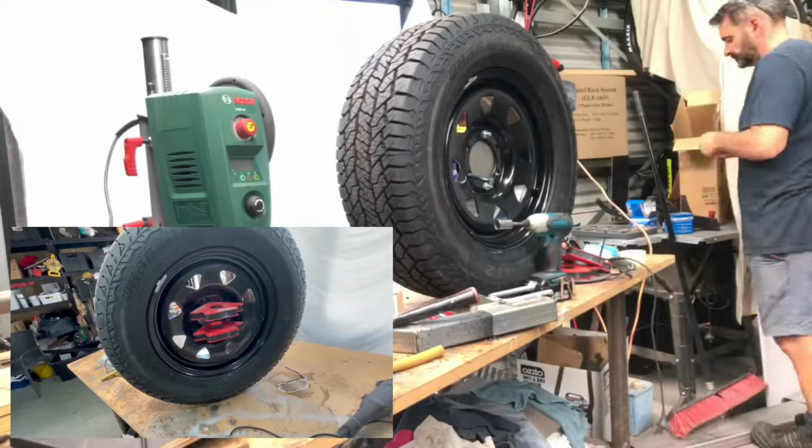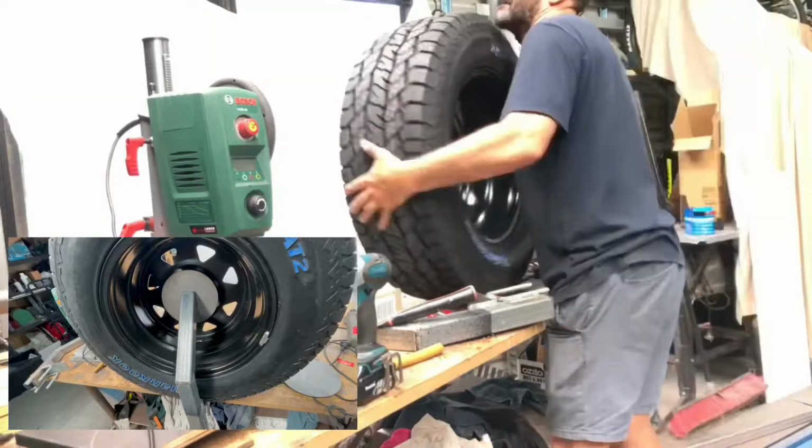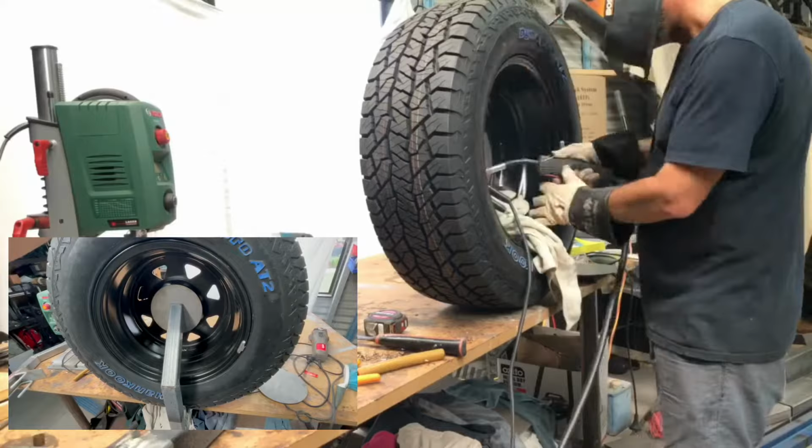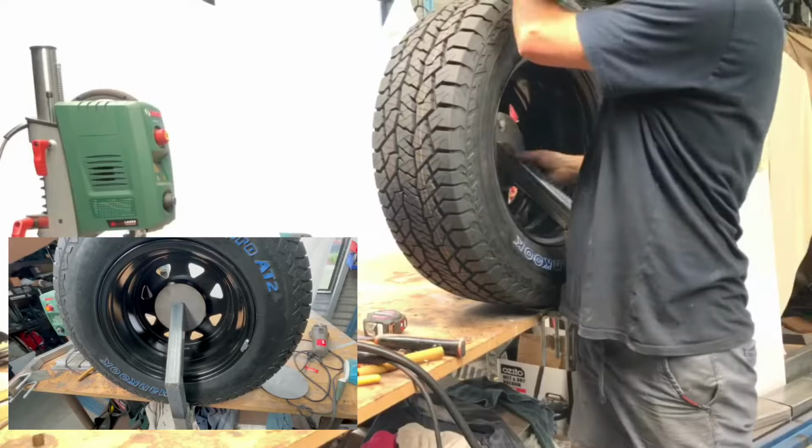So that's roughly the arrangement. Obviously got to weld that off, but what I'll do is get the penetrations, the bolts through first, and get them attached to the wheel with the plate on the back, and then when I sit this into position I can just do a tack weld on it to hold it in its final resting place and take the wheel off and then finish the weld. I think that should be good.